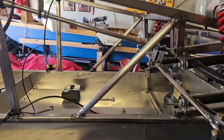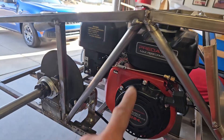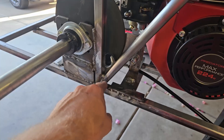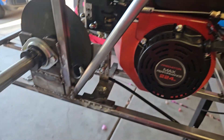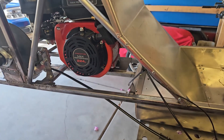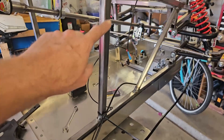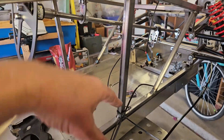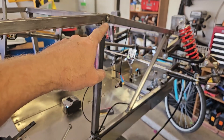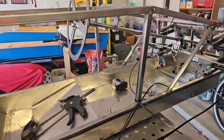Those front crossmembers are welded in place and the ones in the back are gusseted up from where the seat mount is down to where the engine mount is. This is going to get final welded later — I just tacked it up on the areas I can reach; I'll go around the back sides too. After all this mock-up is done we'll take it all apart and finish welding. Next up I'll cut out this bit one at a time — I don't want the frame to collapse, though it should be pretty rigid — and then mount my piece that goes here at a 45-degree angle.